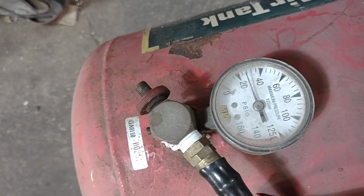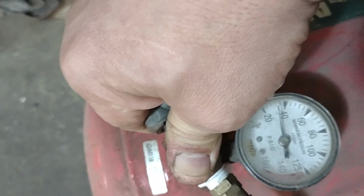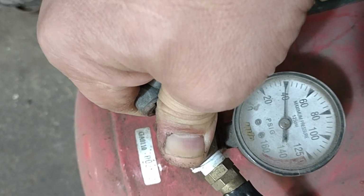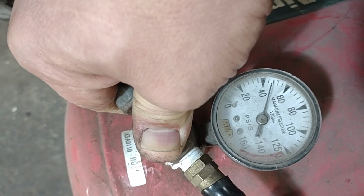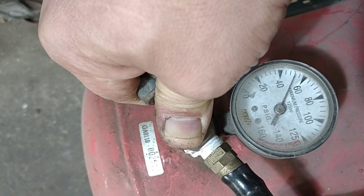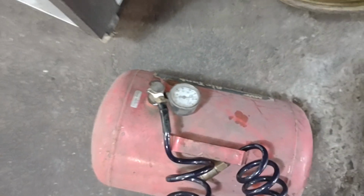First thing I'm going to do, I have to put air in this. So I have enough air here. Right now it's 25 or 30. Let's fill this with air. The pressure here is not going to affect much what I'm doing, but I just want to have enough air inside this tank. I'm going to reach 80, because I'm going to control the pressure inside the fuel injector container that I'm using. So this has about 80 psi. That's enough. I'm not going to need more than this.